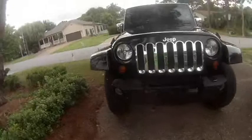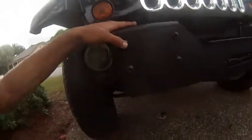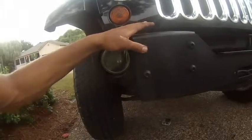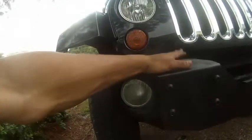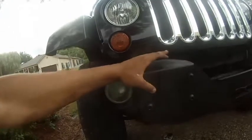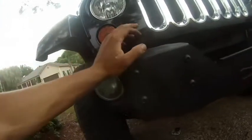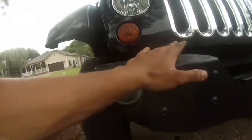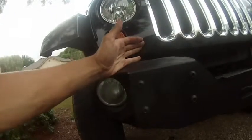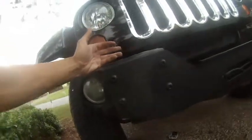Here's the bumper before a winch. You're supplied these Allen wrench type bolts right here in the front, and these are the end caps. You're going to want to put them through the end caps first, and then push the bolt through the winch plate, through the frame, through the little square pieces that your original tow hooks came on.